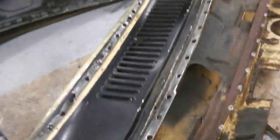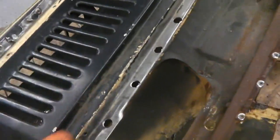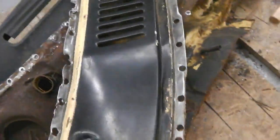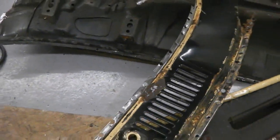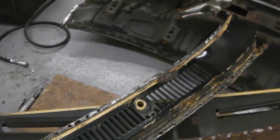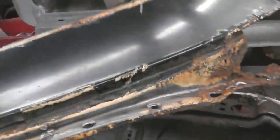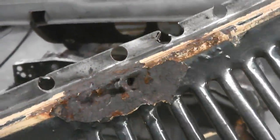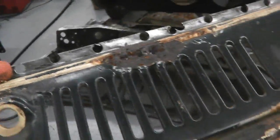I think we did the best we could there. We saved that. I've saved this. It's not dented or damaged any of it. But it could be repaired, because we fit two new scuttle ends to that, and then a piece could be grafted in there off this donor section that I've got, so I can make that into a new scuttle. So that's a good little piece to keep and save. We'll make that into a nice new piece. Easy to get that fixed. Just cut and shut there. So good that we've saved that.